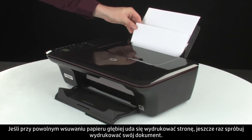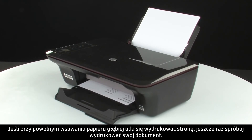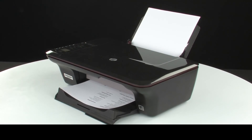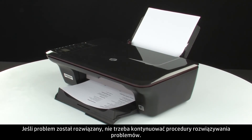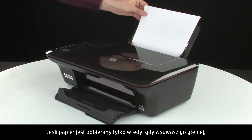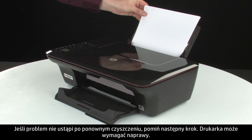If the page prints when slowly pushing the paper farther in, try printing the original document again. The paper might not have been loaded far enough into the printer. If the issue is resolved, there is no need to continue troubleshooting. If the paper only feeds through the printer when you slowly push it farther in, repeat the previous step to clean the rollers again. If the issue continues after repeated cleaning, skip the next step — your printer may need to be serviced.